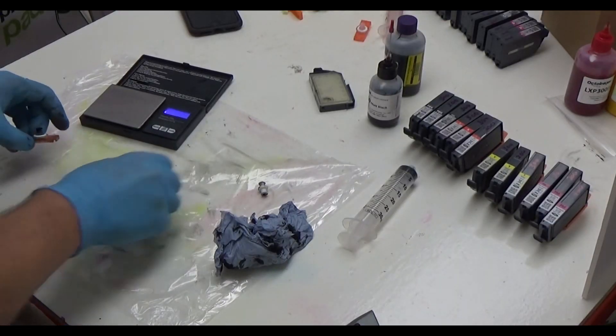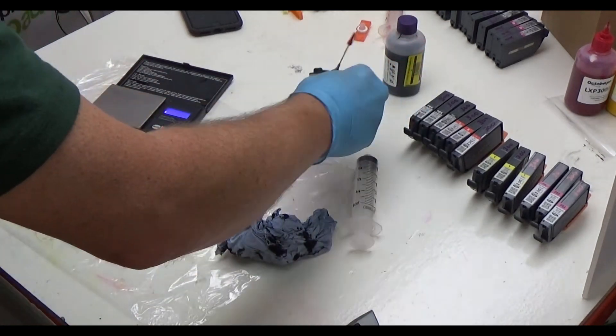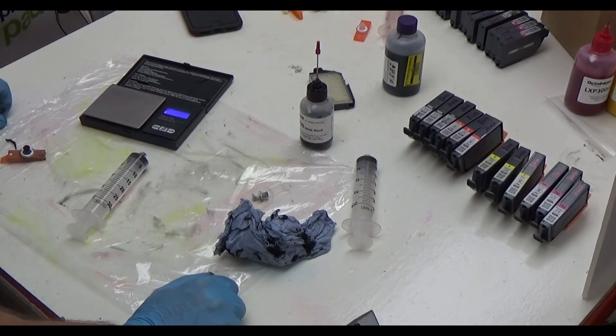So there you go — that is the photo blacks filled using force fill with a syringe just to isolate the bottle, then topped up using the dribble fill method. Hopefully that's been useful — how to get yourself out of a mistake. I'll probably do this as a separate video, so if you found that useful please give it a thumbs up. And if you're laughing, feel free to use the comments to tell me how dumb I am — I'll store that away for when you come back with your tail between your legs having done exactly the same thing.